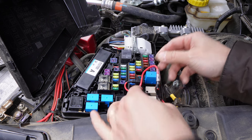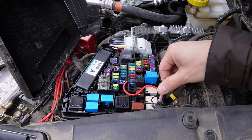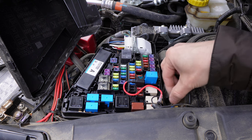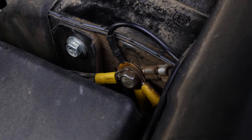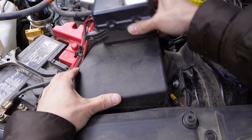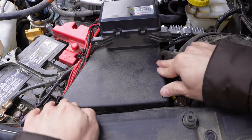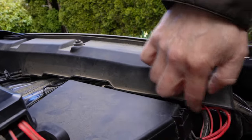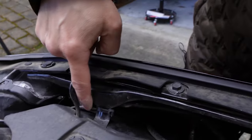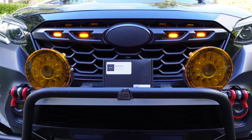You don't need to cut or make holes on the fuse cover to close the cover. The ground wire from the LED light gets tapped into this 10 millimeter bolt — simply unscrew the bolt, put the ground wire ring on the bolt, and tighten it. As you can see, all of my ground wires for my LED lights are on this bolt. Close the fuse box cover and run the wire behind this cover and across the headlights.